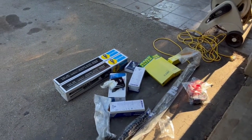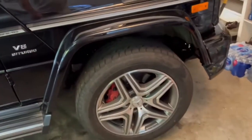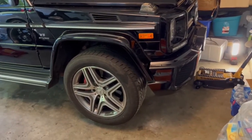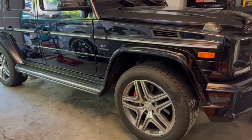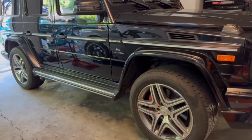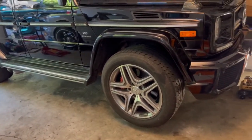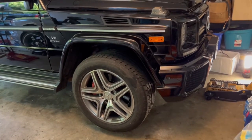Since I'm replacing the rotors I might as well do the parking shoes too. The parking brake works fine right now, but it was really cheap — like $25 for the shoes and $10 for the hardware kit. I'm in the process of putting it on jack stands right now, just about to get the front wheels off so we can have a look at all the suspension components and see what it actually needs. I also ordered new bushings for the control arms since the shop said they were worn out and quoted me Mercedes bushings I can't get, so I ordered polyurethane ones instead.